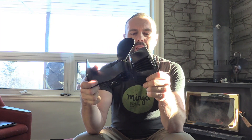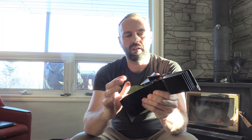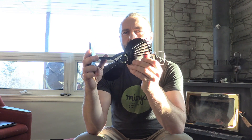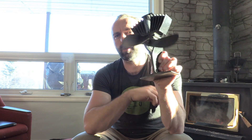It has a lot of merit, except that I have yet to see one that actually does anything other than just rotate a piece of metal that does not push any air whatsoever. The way it works is this little thing in the middle of this white thing is called a Peltier cooler, and it creates voltage to run this little motor right here by creating dissimilar temperatures. This part sticks on the stove and heats up, and this part is a heat sink, so it releases energy, and the temperature differential on the Peltier cooler actually creates a voltage which spins this fan. Most of you have probably seen these things.